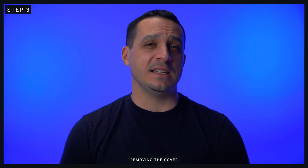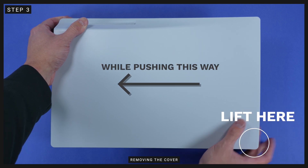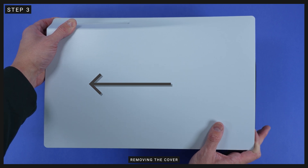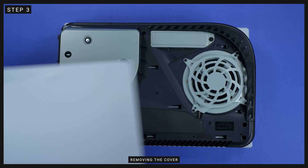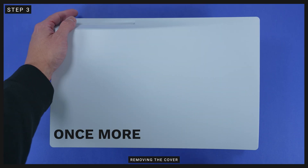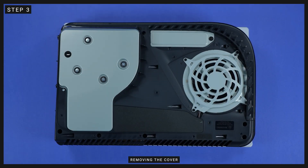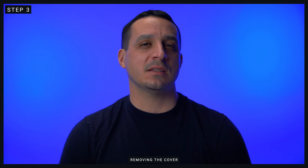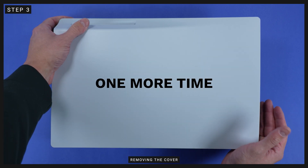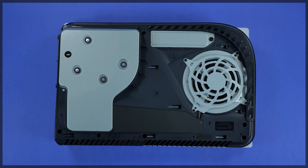Step 3 is to remove the cover that is facing up. Use your right hand to grip the edge of the bottom right-hand corner while you use your left hand to grip the edge of the top left corner. Then gently lift the cover with your right hand as you push to slide it off your PS5. Be careful not to overly exert your sliding motion to avoid scratching the inside of the console's body — just take your time, lift slowly as you push, and the cover will lift away easily.